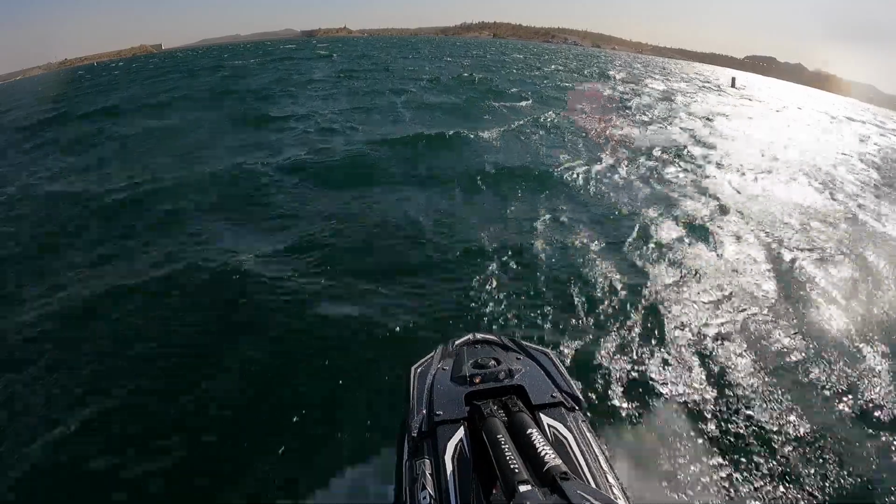So depending on your riding, if for instance you want to go jump boat wakes, and that's more of the riding you're going to do, and you're wanting a little bit of a lighter nose to create more top speed, you're going to run fewer of these. If you want a boat that really dives in hard into the turns and is really hooked up with lots of drive, more hull extensions. So that's kind of how it works, pretty simple, and you're able to tune it to whatever you want.